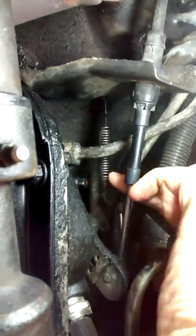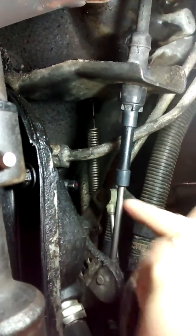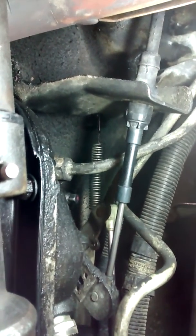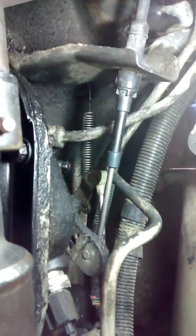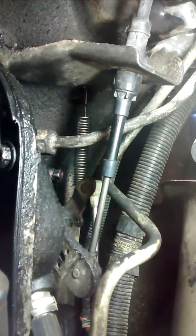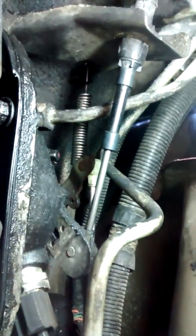You want to push your throttle all the way down with something to get it out of the way. I also removed the spring there - I don't recommend doing that, I don't think I really needed to, and it was a real pain to put it back on. I had the transmission cooler with the coolant line right there but I didn't have to take it off. In fact, I didn't have to take anything off. There is a shield pan though - I did have to bend that up to get the tools in there, then I just bent it back down when I was done.